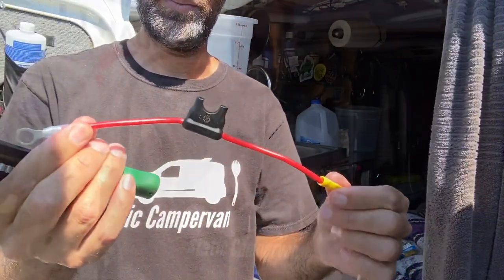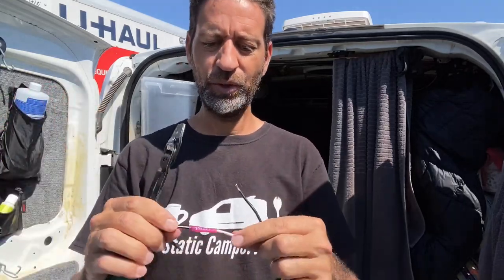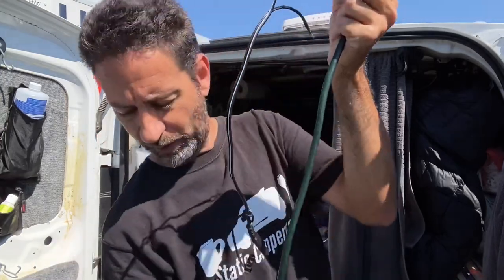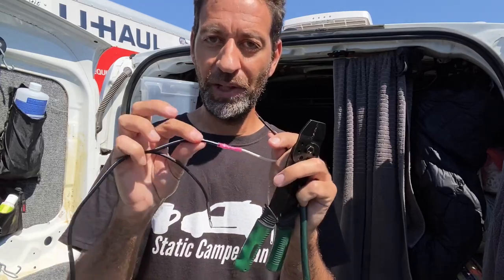There are some questions on this, but as long as I can unplug it if I need to, I think that's the best way to go. I'm not quite sure if these ring terminals are going to fit, so I do have some new ring terminals here that should fit my battery. I'm also going to need to splice on a fuse holder, just because it's a safe idea to have a fuse as close to your battery as possible. One thing I wish someone would have taught me — I just recently learned it — is that when you're using crimpers and crimping on connectors, whether they be butt connectors or ring terminals, you need to resist the urge to twist the wires together. The way these connectors work is they pinch down over the wires, and if you've twisted them together, they can't pinch and grab on. So just leave the wires straight, and you'll find much better success when crimping.